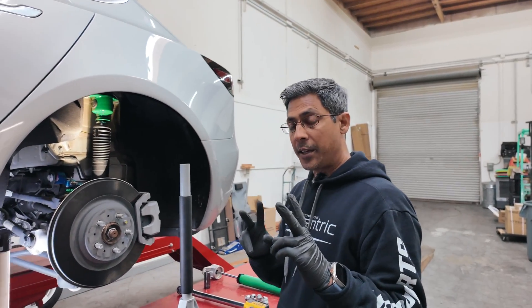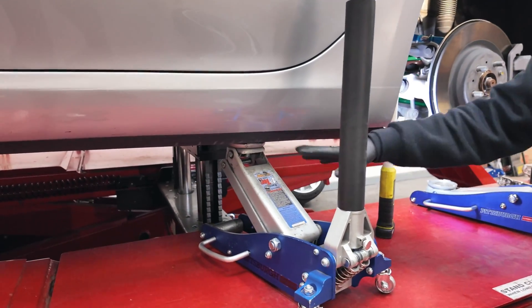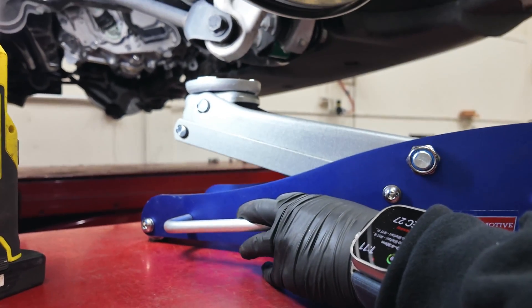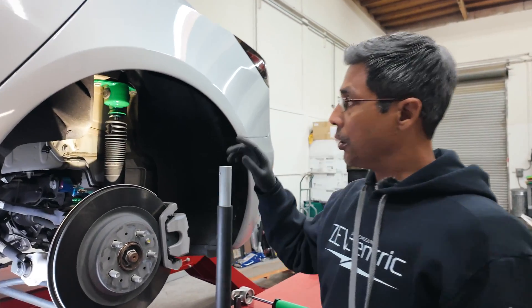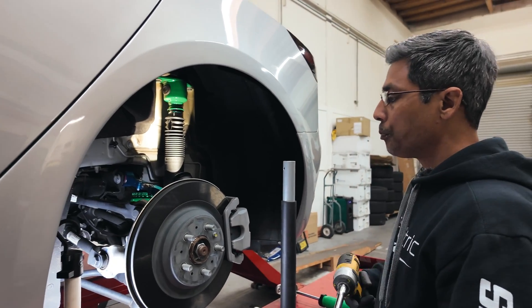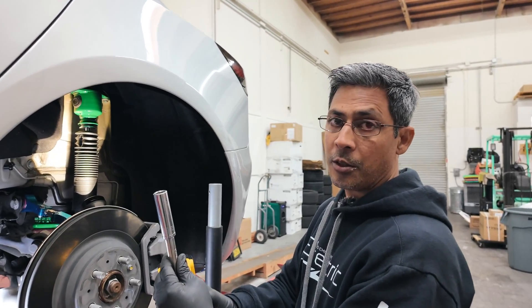You'll need two jacks. This is as if you're a DIY at home — the vehicle is up on an alignment rack right now, but just pretend it's jacked up and you've already removed the wheel. Take the second jack to support the knuckle or the spring arm so that when you drop the shock down, it doesn't drop the spring arm on you. There are two 15 millimeter head bolts right here and here. When you drop those down, you don't need to touch the 21 millimeter bolt on the bottom, and you don't want this spring arm to drop at all.